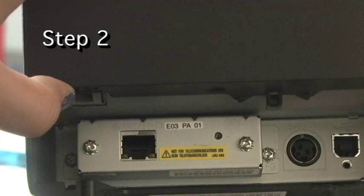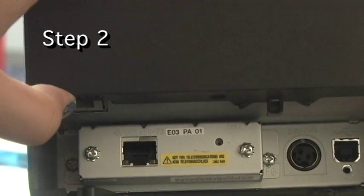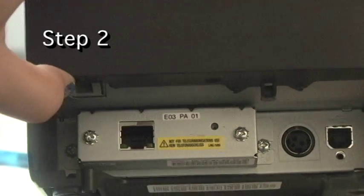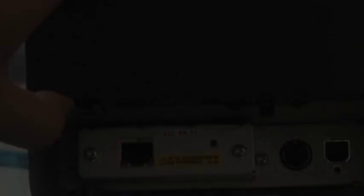Check your interface card in the back of your printer. It should be connected by two screws. Also, make sure your dip switch settings are correct. You can check this on our website at beaglehardware.com. Test your printer to make sure it is all running correctly.